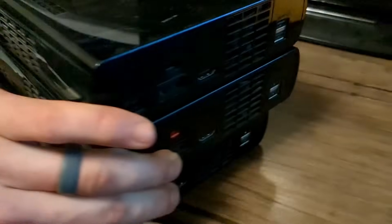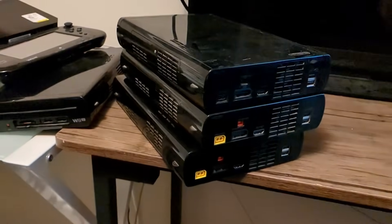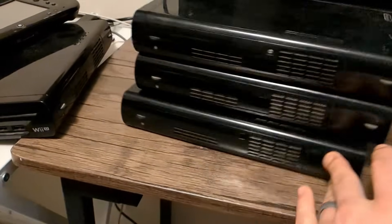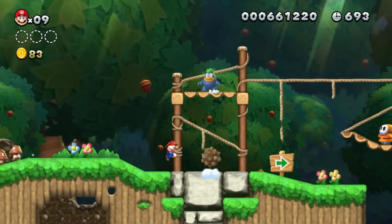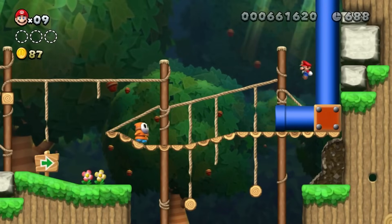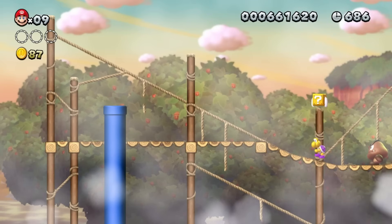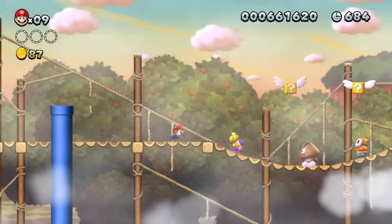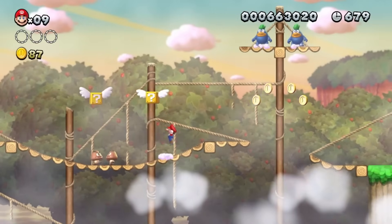However, if the ports are colored, then there's a higher chance it's a Hynix chip. Not all Hynix chips fail — there's just been some reports of that happening. So this first method is very quick and easy, but it doesn't guarantee a definitive answer. It's mainly for anyone planning to buy a Wii U from someone else and doesn't have time to check the guaranteed way, which I'll show you next.